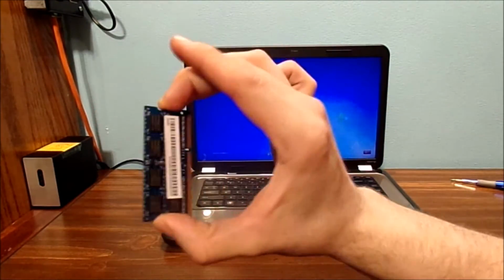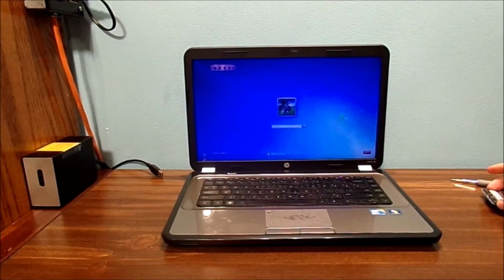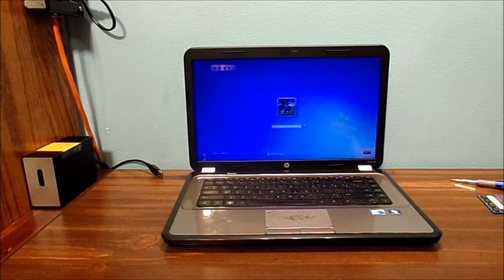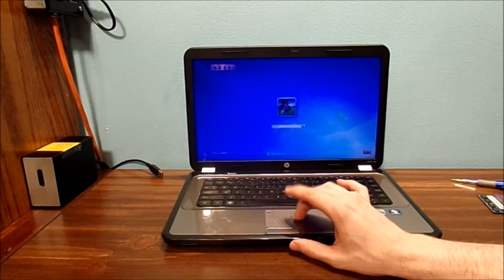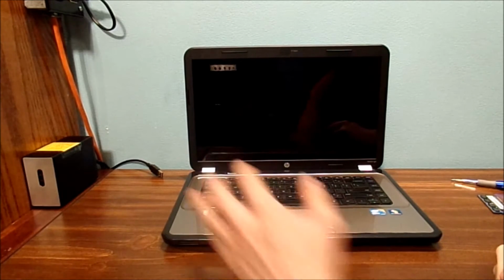Now, this is the RAM module we're going to put in, but is it going to boot, or is it going to work or crash like it normally did with the DDR3 8GB modules of RAM? Typically, the motherboard can only go so high in capacity. Now, one thing we gotta do, restart this computer. Okay, we got to go to that escape key once it boots up, and I'm going to show you what it's actually using.